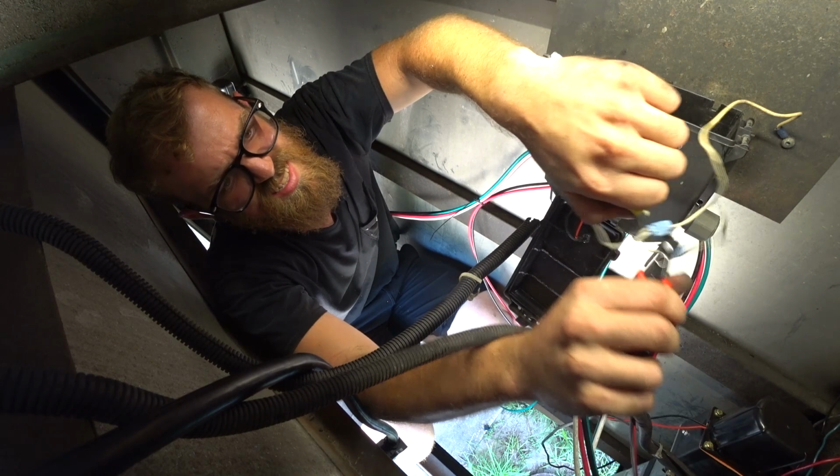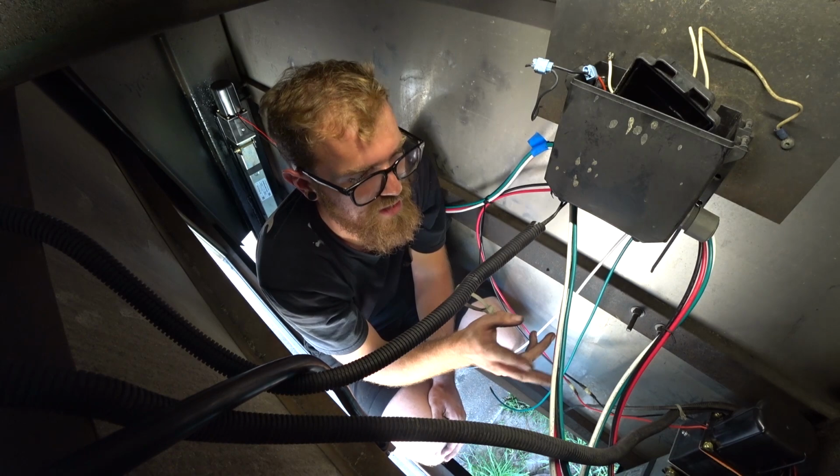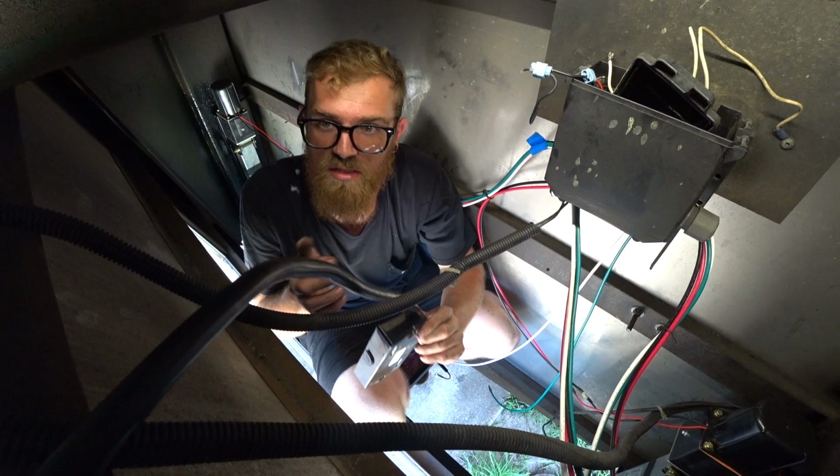These are obviously our jack wires. We need to loom these, P-clamp them, route them. We're gonna have to run the ground of each one that goes to the battery through the battery kill switch. So that way when we kill the battery power, the switches aren't operable because they're wired straight to the battery. They're not wired through like the trailer harness.